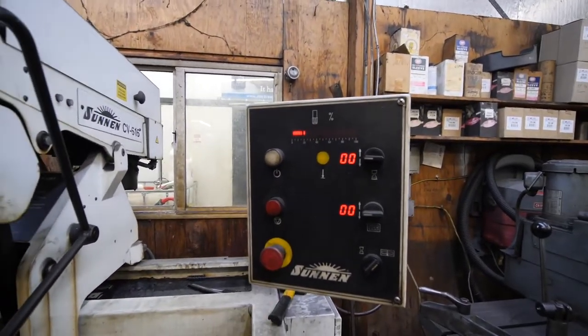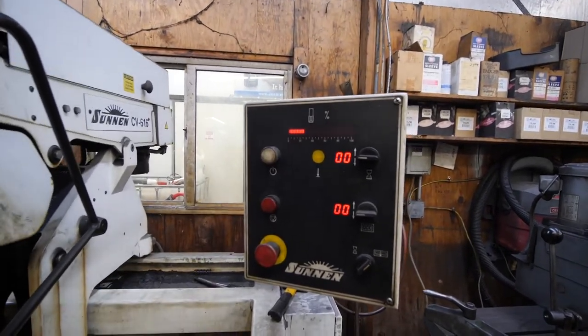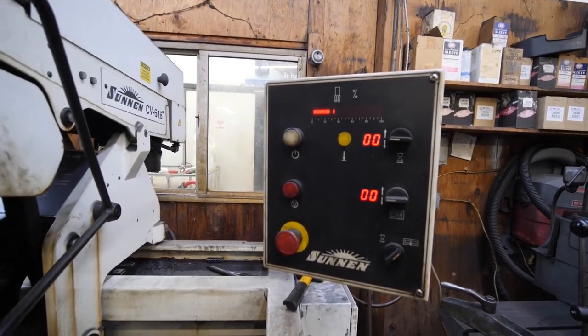That means the hone's at the very bottom of the cylinder. This is a pressure readout as to how hard it's forcing on the stones, so we can tell if the bottom's small or big compared to the top as it's honing.